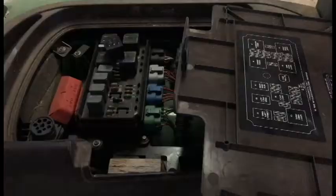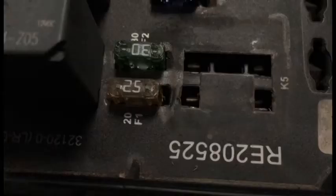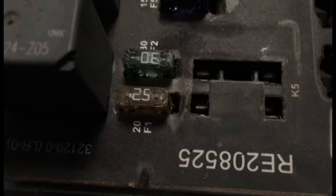Stepping into the cab, I'll first show you the main fuse block area. F1 is a fuse that keeps blowing whenever I replace it — I've already gone through a couple fuses. I've replaced the 20 amp with a 25 temporarily, but nothing larger than 20 should be inserted here.